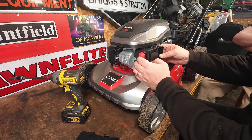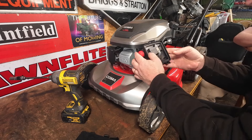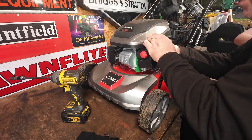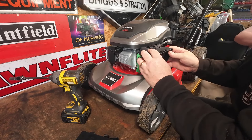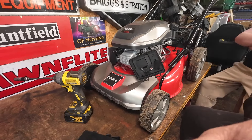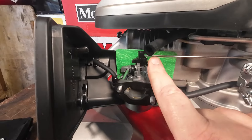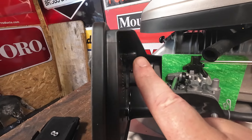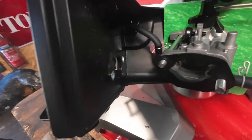So look — does that come off? We've got the air pipe on the back that needs to be disconnected. The vent pipe at the back will be really hard to get off because it's brand spanking new. These are very similar to a Mountfield 414s. Before you get the carburettor off, there's a little tiny pipe here — that's got to go on that little tiny tube there when it goes back on. That's your crankcase breather pipe. And then there's a little tiny pipe on your primer with a little tiny clip.